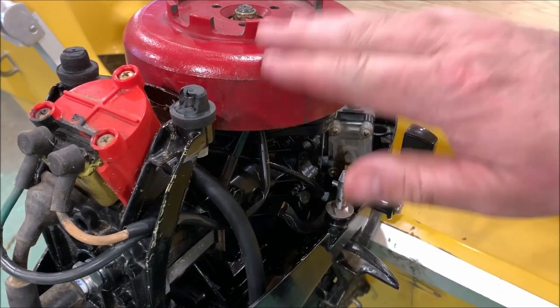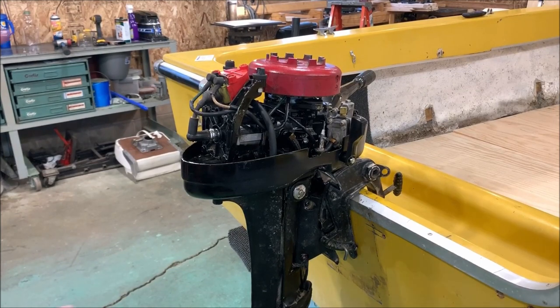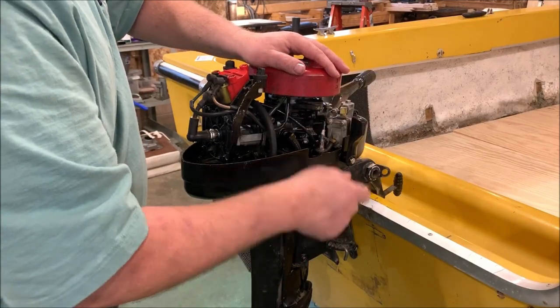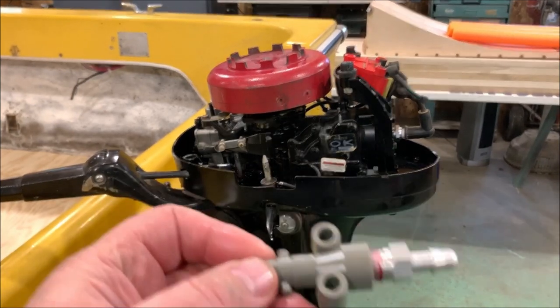Works great. The key, the secret, or the key, whatever you want to call it, to installing this lid is you want to make sure you push down on it and get it nice and tight down before you close it, so the cam can actually suck the lid the rest of the way down without bending your pins.